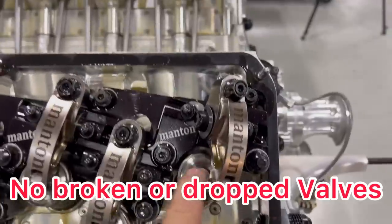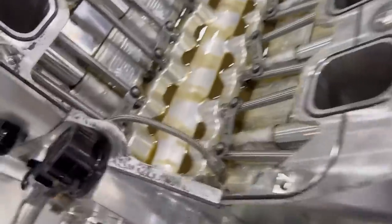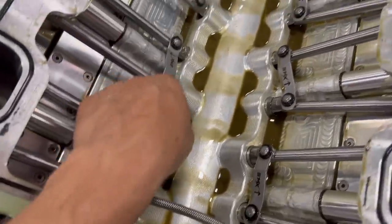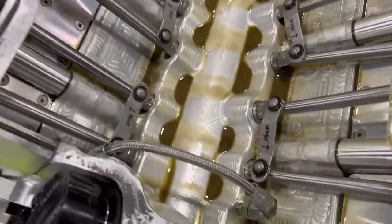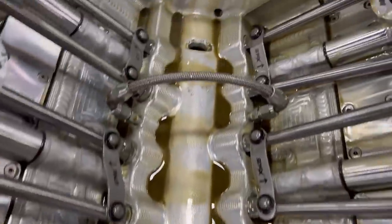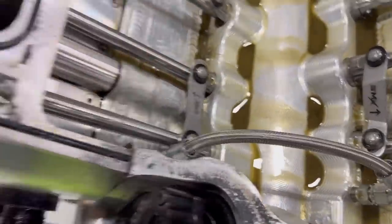This is absolutely the result of the piston coming up out of control after the broken rod pushed it up there. You can see that here's a little piece of it. The lifters still all look good, which is nice. This one will obviously be hurt because that rocker arm stopped intake.